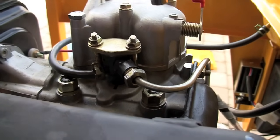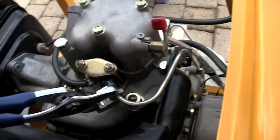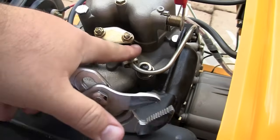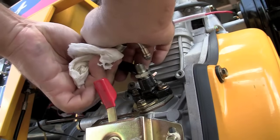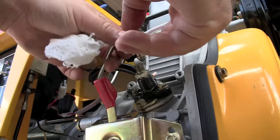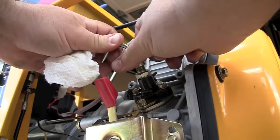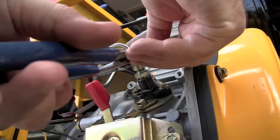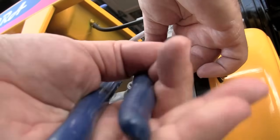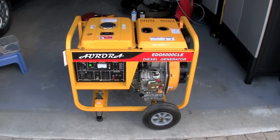Difficulty seating it could indicate some compression loss. Make sure your fuel lines are tight — nothing's going to leak and the engine won't run if they're not. The high-pressure fuel line has some flexibility in it; you can bend it a little bit back into shape so you don't cross-thread it. Once you've got it lined up, you should be able to get it finger tight. Final turn you can do with the wrench. Keep down on it a little bit and you're done — it's not leaking, and that's it.